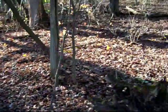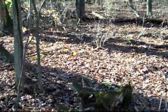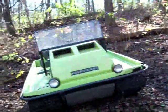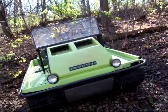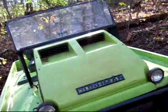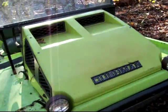Anyways, climbing this slope, I decided to turn around and come down the hill, and as soon as I did, the engine quit. So I took a VOM, and my first thought was the CD amplifier. So I pulled the spark plug, no spark, and thought the CD amplifier was bad, but then I did the regular checks,